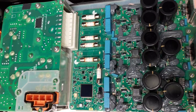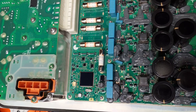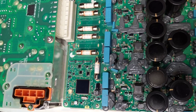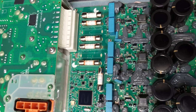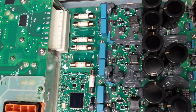Here are the only fuses I'm aware of in the Model 3 — first ones I've seen; they don't exist anywhere else so far. There's a TMS320 there, looks like doing the heavy lifting again — Tesla's favorite go-to part. Looks like the same board is used in the European models where they have a three-phase input; you can see the missing fuses.